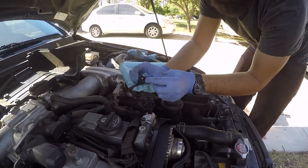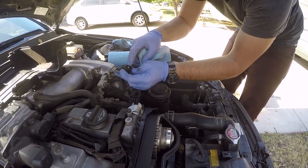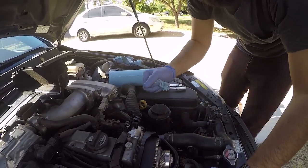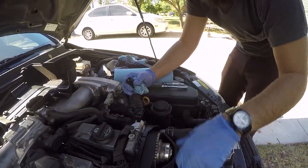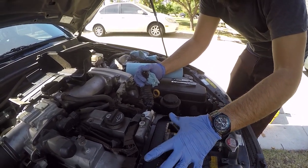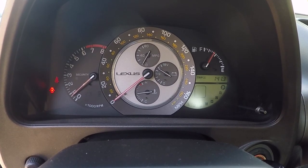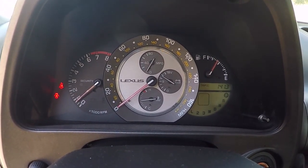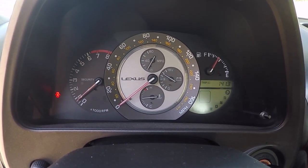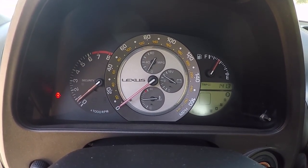Because the connector was full of oil, I'm going to grab the air compressor and blow this connector out to make sure it's not shorting out the new sensor. Then put the cover back on with four bolts — they don't really need to be tight, all they're doing is covering up so nothing gets caught in the belts. I've cleared the codes and the light is not back on yet. I won't really know until I give it about a 30-mile test drive. So we should have fixed the problem unless we got a defective solenoid from the eBay listing. But this is how you fix your problem.